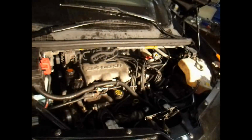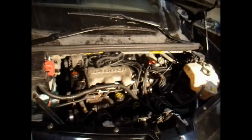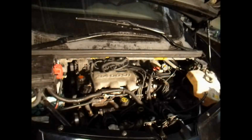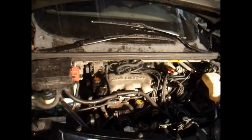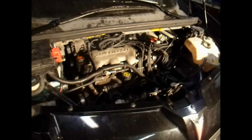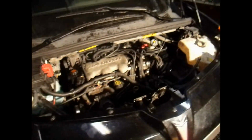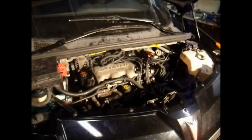It's still burning off a little bit of the oil and everything that I had from when I was handling the manifolds, but, you know, that's common. It's going to smoke a little bit whenever you first start it up because it's burning off all the stuff you touch off the manifolds and areas that have gotten hot. But it is running, as you can see and hear. I'm happy with the results. It runs great, just like I knew it would.